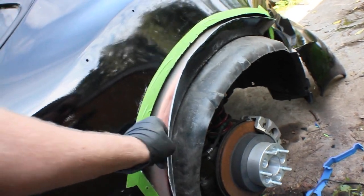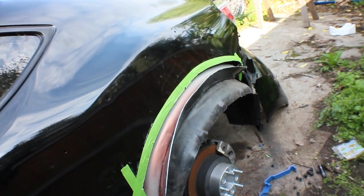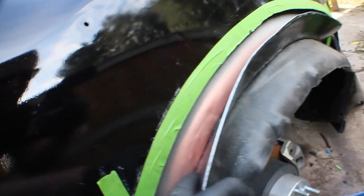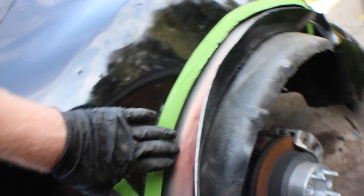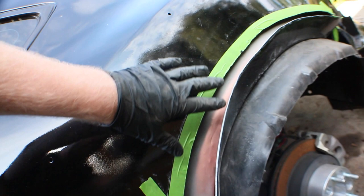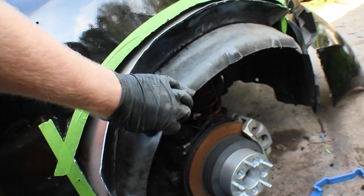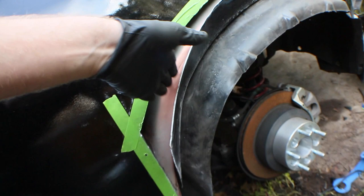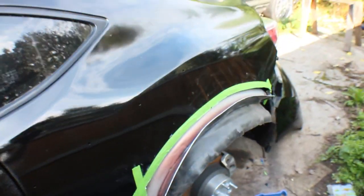The second time I came through and I just cut the outside skin. I wanted to tell people — I'd seen other people do it cutting through both at once — but there's a better way, because when you cut through both of them, now you've got to come up with some material to bridge this gap so you don't get water in here. When you leave this inner skin fully intact, there's just a couple spot welds here holding this on, so I'm going to bend those and pop those off. Now I'm going to take my cutting saw and cut some lines in here so this metal can flex, then bend this out and bridge that gap. I can come back in with a tack welder, or you could use fiberglass filler — anything to attach these two skins to keep the water out. Your mud flap and mud guard is going to keep a lot of this moisture out as well, but you want to have a backup. Doing this was a lot better, and I'm going to have this metal to work with — I don't have to come up with some other fancy solution.